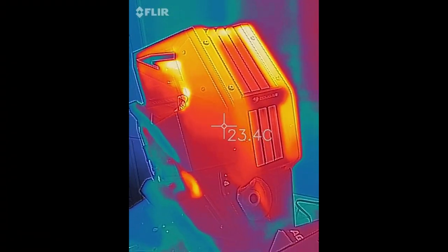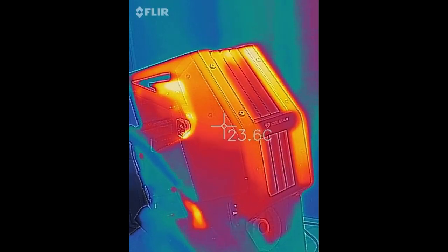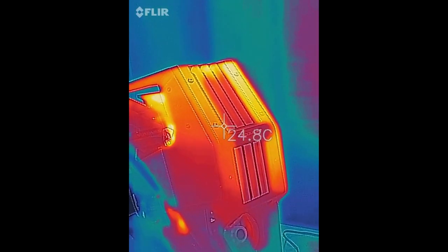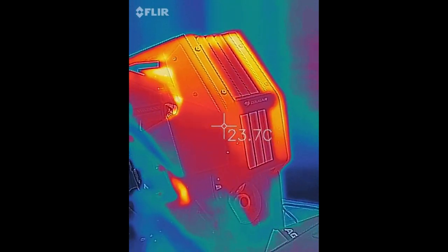So really, that's not too bad. I was expecting to see numbers a little higher than that. But like I said, it depends on the number of fans you use and the fan speed. Time for a little thermal imaging. The system is cranked up on a mild overclock — 4.1 gigahertz on the 5820K from Intel.